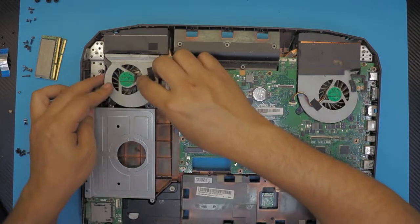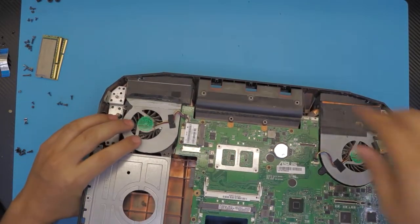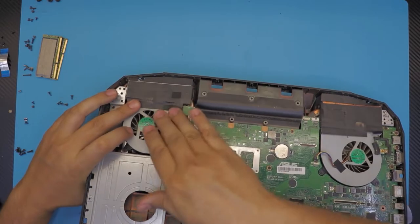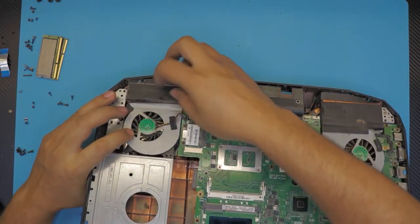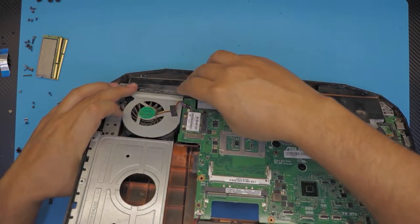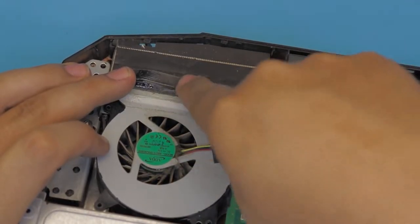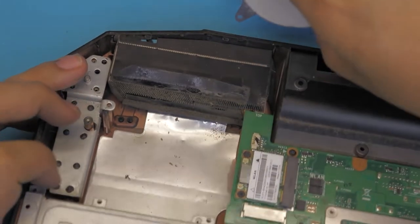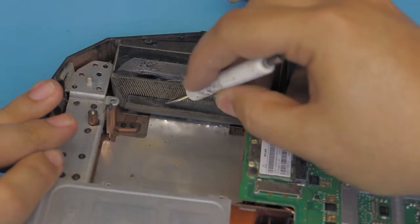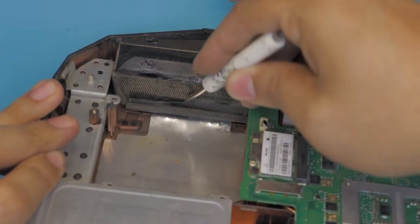As you guys saw, the fan was right here, and this plastic thing right here was over the fan, so the air goes through the heat sink and comes out from the other side. So this one is okay here, right? Once I remove it, you can see the fan air goes in from the other side and goes through the heatsink. But once I remove this one, what do I see here? Instead of opening, it's just blocking the air so the air won't flow through the heatsink.